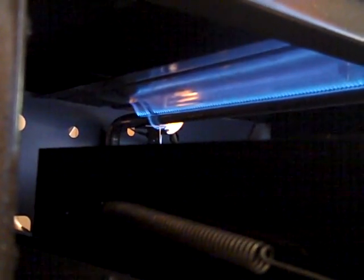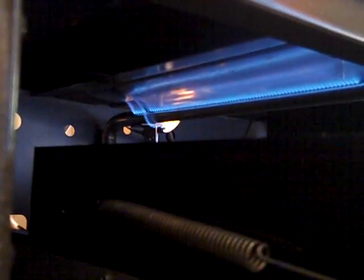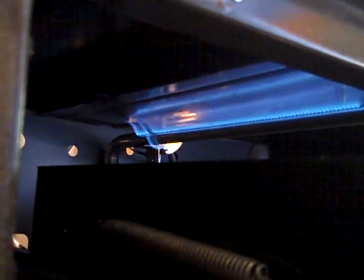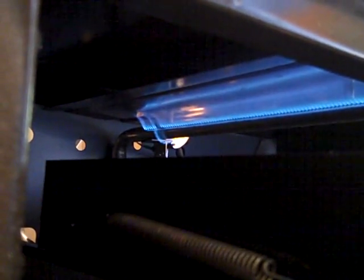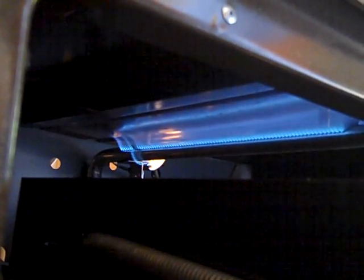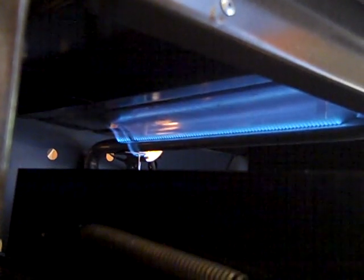You also have to adjust the orifice on the oven and get the pilot light going. You do the same adjustment to the top burners on the oven — turn the orifice in for propane and adjust it so you've got a nice blue flame. To fine-tune this, there's an air shutter that you can slide to adjust the amount of air going into the combustion, and you can fine-tune it that way — just move that slide in and out.